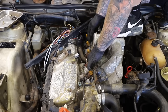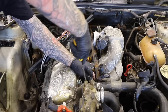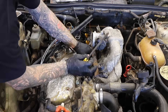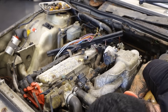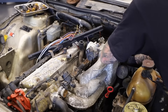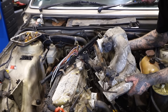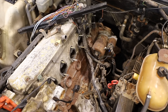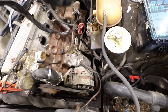So it's onto removing the inlet manifold. The first thing blocking that are the injectors with the fuel rail — again, all of this is going to need to be replaced, and the injectors look pretty cruddy; I'd be surprised if they've ever been changed. Once the fuel rail and injectors are out of the way, I can start working at the bolts which hold the inlet manifold to the side of the engine — about two bolts per cylinder, so 12 bolts in total. Once they're all out, I can remove the inlet away from the car, which gives much better access to that wiring loom so I can move it nicely out of the way ready for when we pull the engine out.